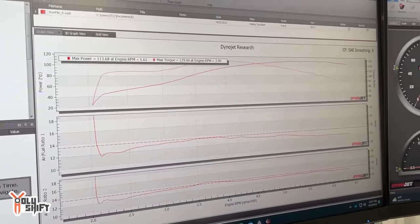More tweaks at the end of the run. The exhaust is getting browner and browner, closer to bronze. I'm happy with the line right now, so we're going to do one more auto-tune session and see if the auto-tuner wants to make any changes. Then we'll do the final runs. As I can already tell, the low end has picked up a lot.